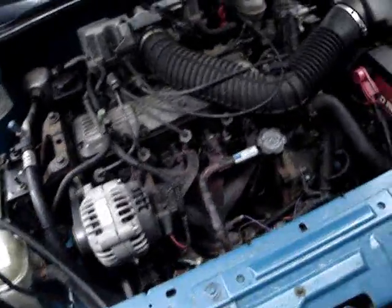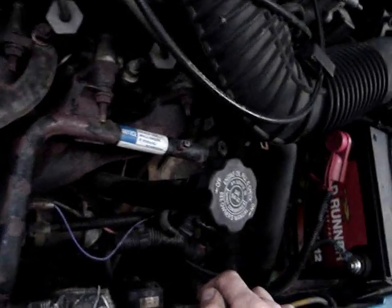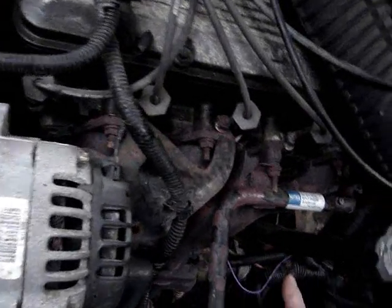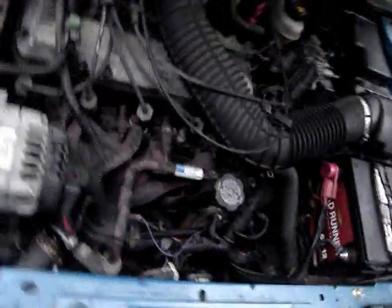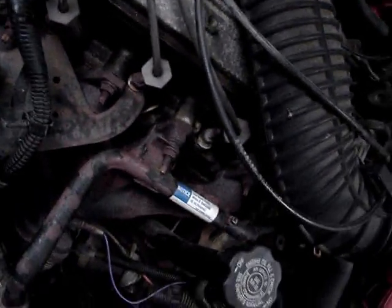Well, here she is, the finished project. I should have videoed bleeding it, but it was pretty simple. You know, bleeding the air out of the coolant system. I did have the front end up in the air a little bit, and this little screwy jobby here that a lot of people say twists off worked pretty good, because this tank is actually higher than this. To bleed it first, standing still, I took an air compressor hose and put it on low air and stuffed a rag around here and put some pressure in there until it blew out through here and worked really well. And this little screw job is higher than the heater core. It actually worked real well.